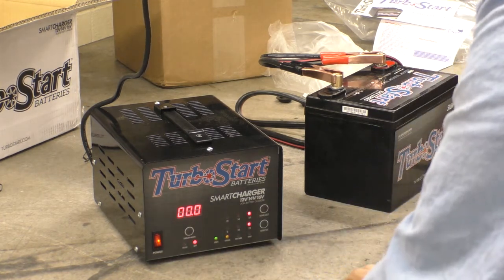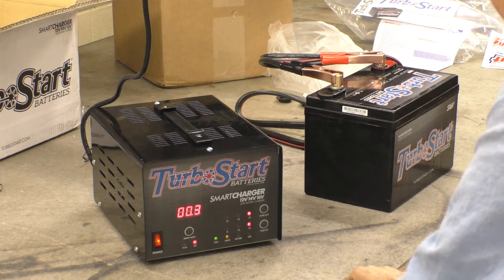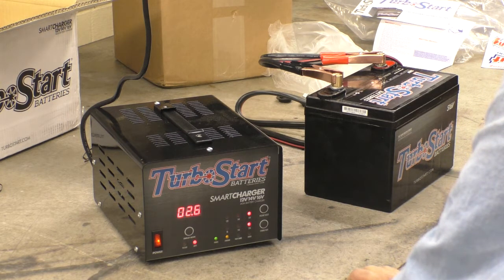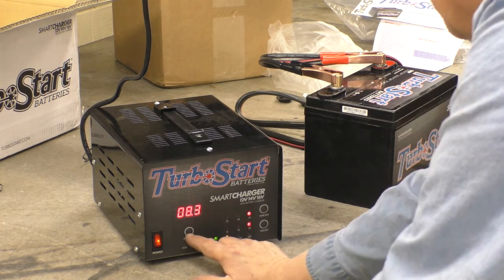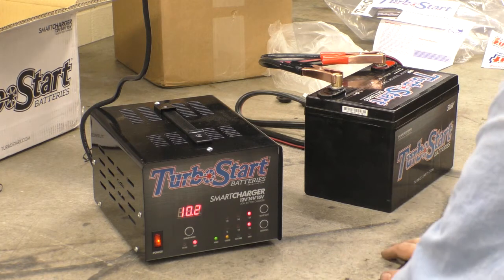On. Wow, it went right to 16-volt and 25-amp, and it is charging. This thing is an intelligent charger — it figures out how dead the battery is and charges at a steady voltage and amperage to start with, and once it reaches a certain spot it ramps that off. Right now it's ramping up. It's at 18 volts charging and 10 amps.